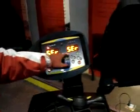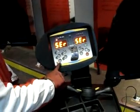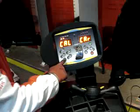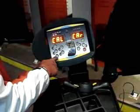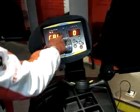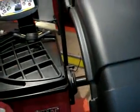So this is service, okay? And this is number 3 button, we press one more time. So this is a calibration card, okay, press one more time. So this is Cal 0. Empty shaft, no wheel, and just lower down the wheel guard.